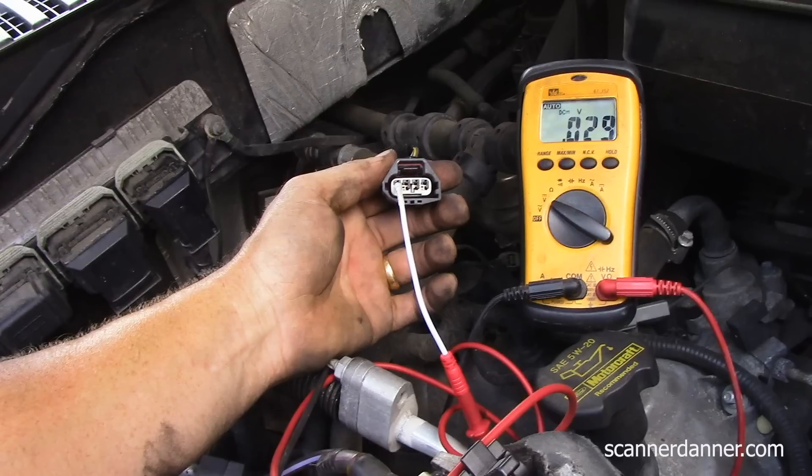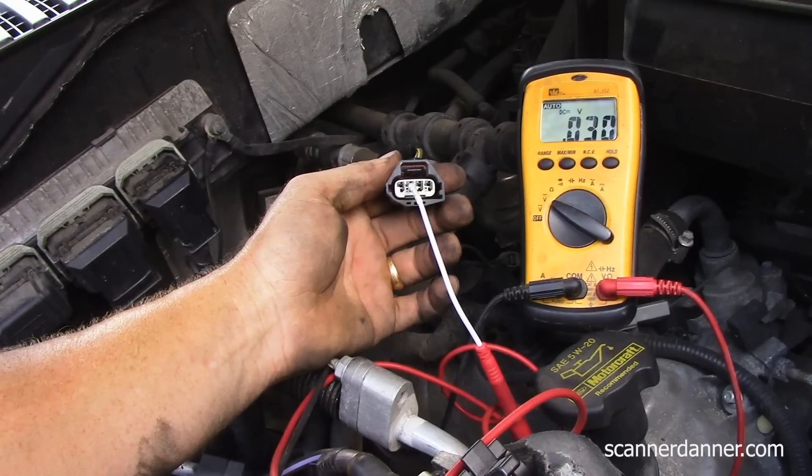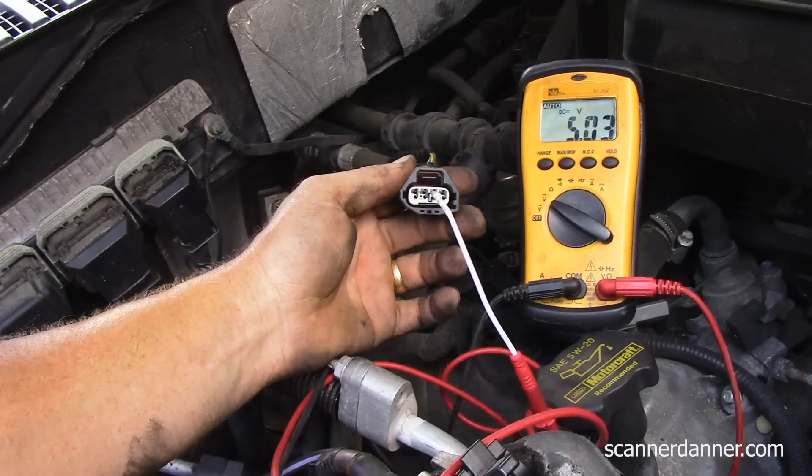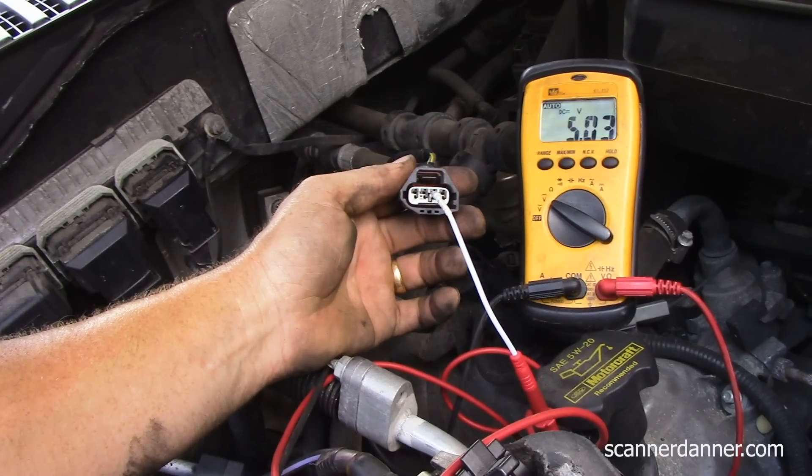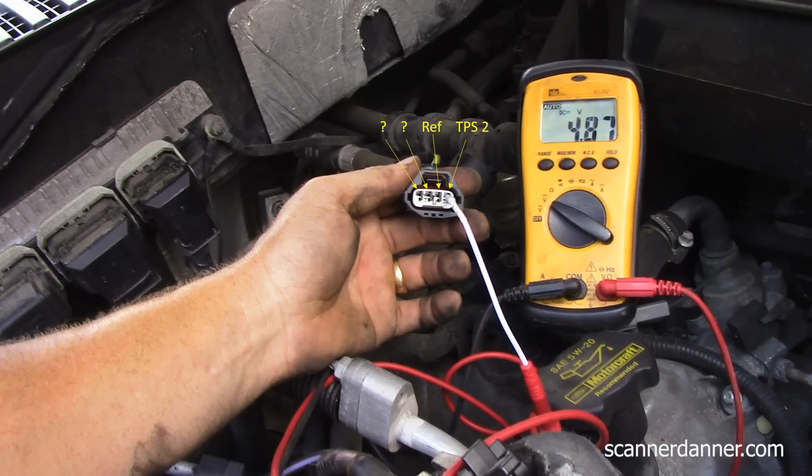I can't find this anywhere in service information — it ain't there unless I have a factory diagram. I don't know why they're using a bias on TPS2 and no bias on TPS1. Doesn't matter. This is the car, nothing wrong with it, I'm just showing principles. Can we apply them? Wiring identification without a diagram? Sure. Let's look at the lines: first one is zero volts, next zero volts, next five volts, next 487 millivolts. Do you understand how that final measurement lets me identify at least TPS2?